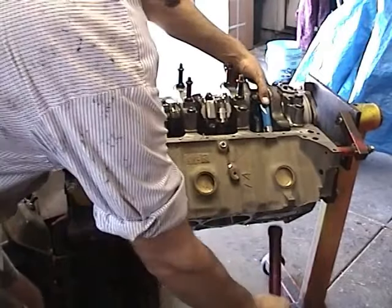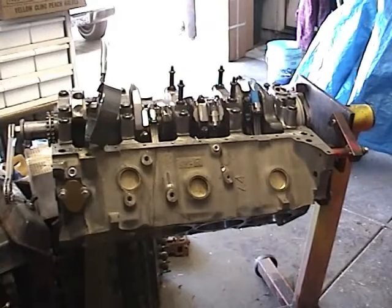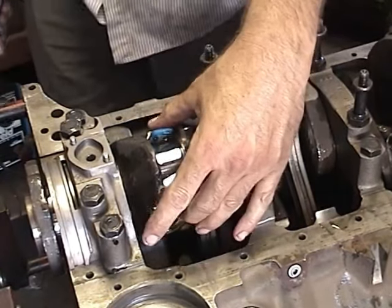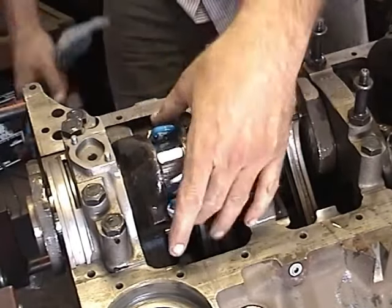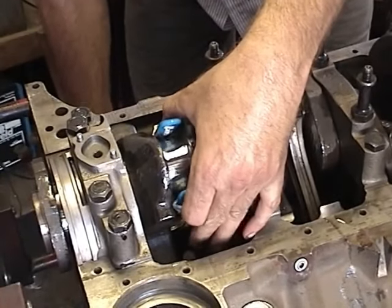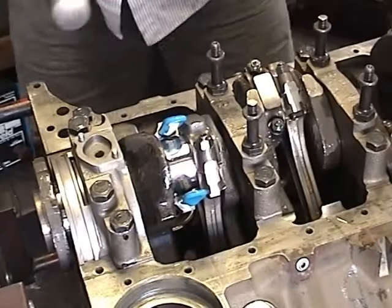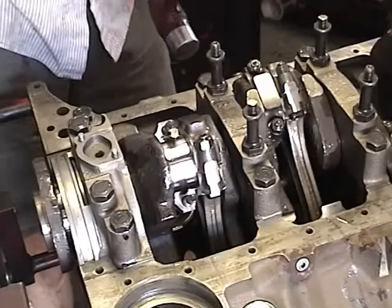I'm going to go ahead and tap this in now. I'm going to move the camera to give you a little better angle. As you can see, I've got that piston halfway in. Everything's lining up fine — I can wiggle it side to side and up and down, so that means nothing's binding up. We're just going to continue tapping this piston in as we guide that rod bearing in around the crankshaft. Just want to be gentle on this part because you don't want to scratch the crankshaft. Make sure you put a good amount of assembly lube on that bearing on the crankshaft before you put that in.